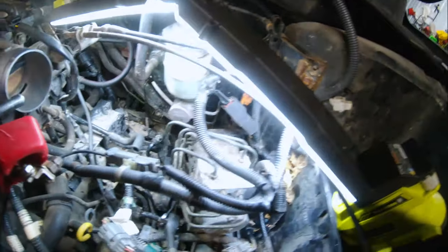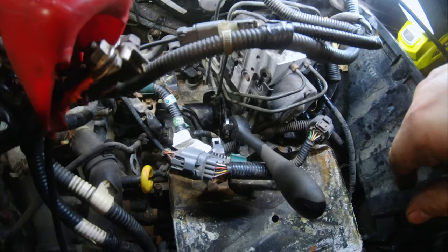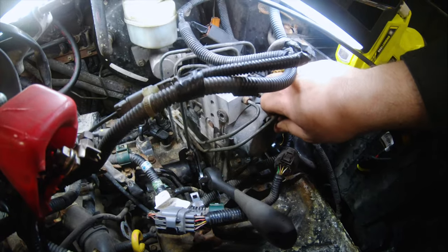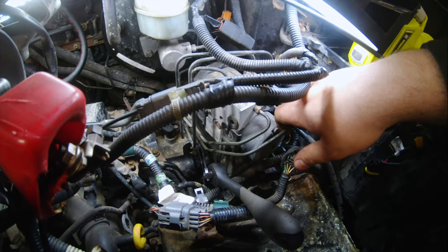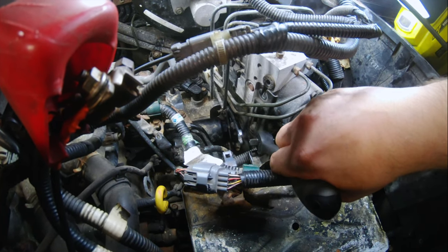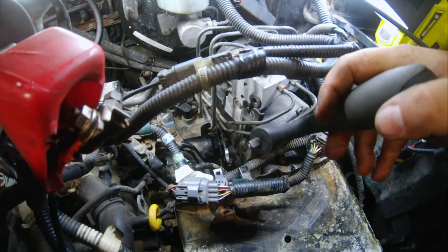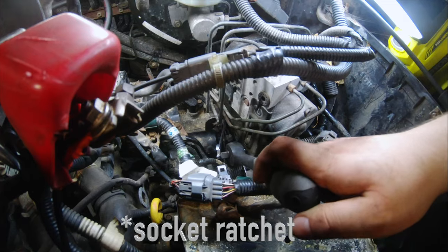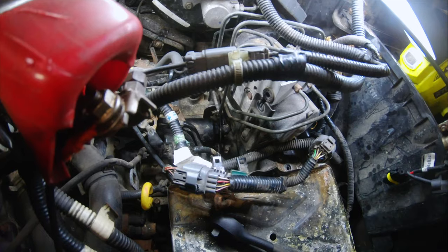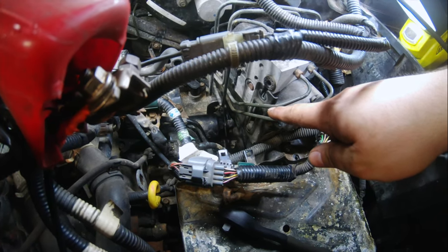One of the challenging parts is removing these two bolts — one up here and one down here. The only way I've been able to do it is to remove the bolts for the ABS modulator, then take a 10mm and where the open end is, put a 3/8 socket in there. You can then use the socket as a leverage bar to break it loose. At least the bolts hit the ground — the bolts are loose, so the bracket should be coming off.